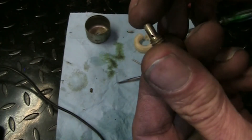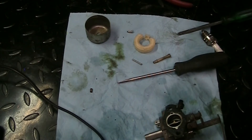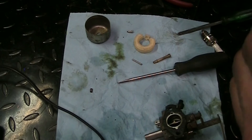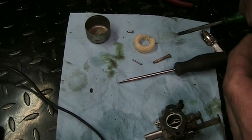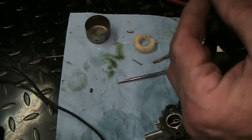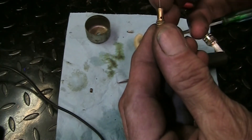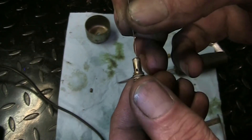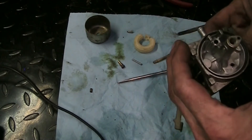In this little pilot there's a couple of holes - there's one there, there's one there, and there's a tiny microscopic one in the end. Before they go in the ultrasonic cleaner, I usually try to push a little wire through them to make sure they're at least thinking about being clear. What I use is various sizes of guitar strings - they work pretty good. A real small one works real good for a lot of these carburetors. I can see the wire going in the end, I can see it in one of the holes there, so I know it's at least partially clean. Sometimes they can be really really goopy in there and they don't want to clear out.